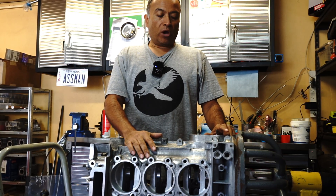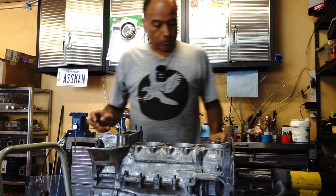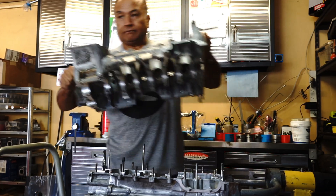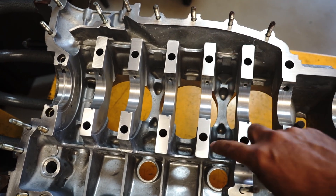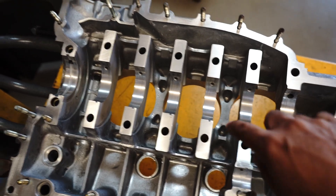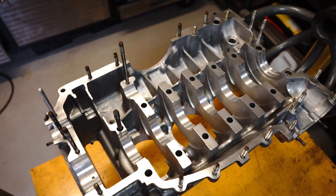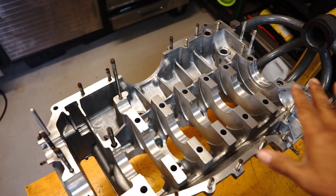There's a differing opinion as to how much sealant you put on the case. So what I'm going to do, while I've got this fresh case that's ready to go, is use it as a test subject. I'm going to take the case apart. The bone of contention is: do you apply the Loctite 574, or whatever sealant you're using, to these web areas? The crankshaft runs through here in the main bore, your through bolts run through here, and there is some differing opinion as to whether you're supposed to put sealant on here. I'll bolt it together, give it a nice dust over and a clean, bolt it together, and measure a couple of the journals in here. I've already sized the case so I know it's good for assembly.